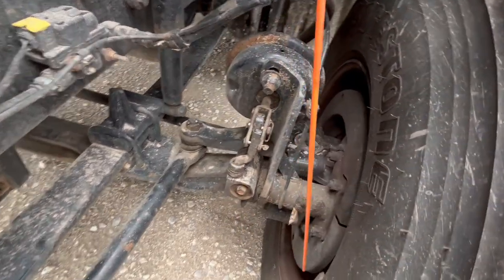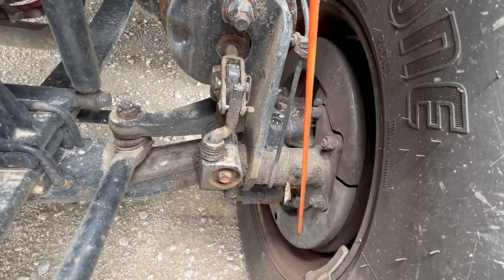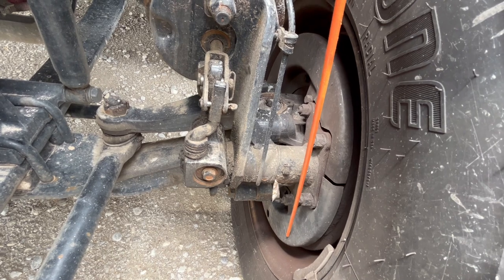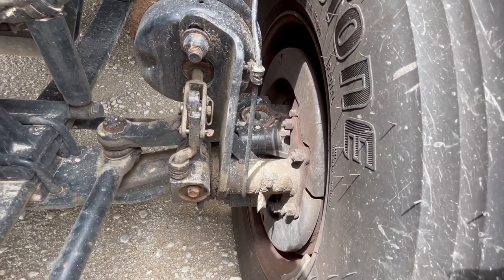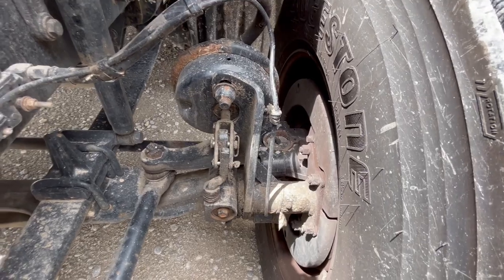As we move in, you've got a brake drum. The brake drum is properly mount secured, not cracked, damaged, or missing, and is free of any oil or grease residue which would cause failure. The brake shoes are properly mount secured, not cracked, damaged, or missing, and there's no less than a quarter inch thick of pad left on them.